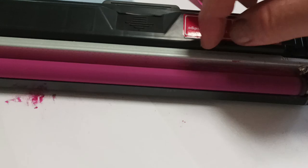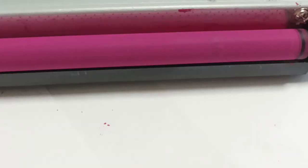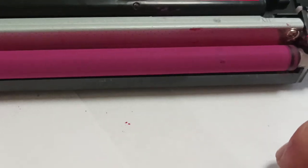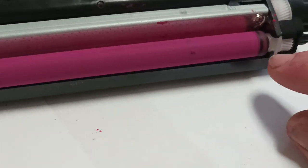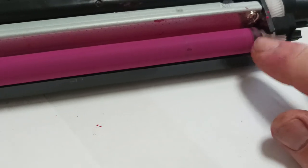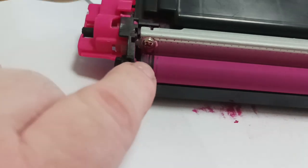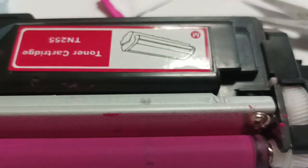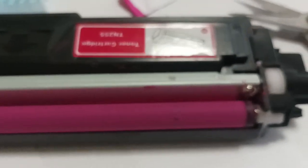After running the paper up and down a few times, the spread over the roller has dramatically improved compared to what it was before. We still have a bit of an error in here where something is obviously stuck behind between the roller and the metal doctoring blade. We also need to clean up the roller because by moving the piece of paper upwards and downwards we've now introduced toner into the felt bushing — the no-man's land — and we have to deal with this, otherwise it will promote leakage of the cartridge into the chamber of the printer.